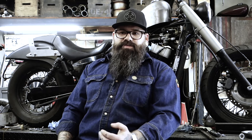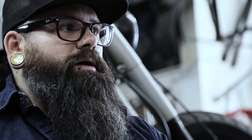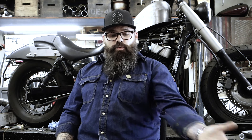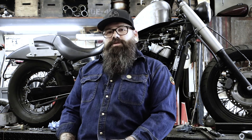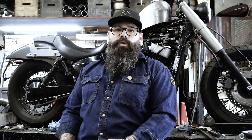Okay, so I've encountered this situation a couple of times where somebody messages me or sends me an email saying my crankcase breather is spewing oil everywhere. I recently had a guy send me pictures of his bike — he came out to it parked outside and there was oil all over the ground, a five-foot-wide lake of oil around his bike. Out of the dozen or so times people have hit me up with this, every single time it's because somebody overfilled their oil.